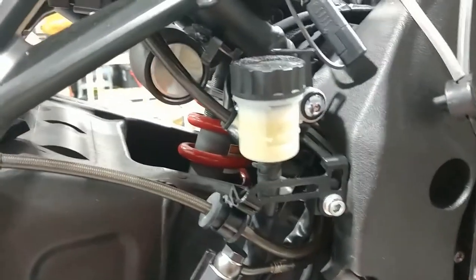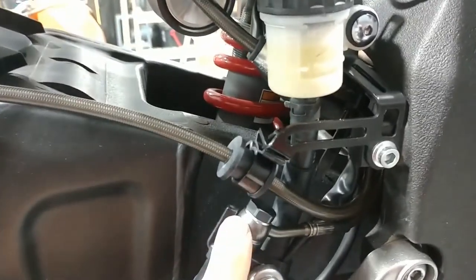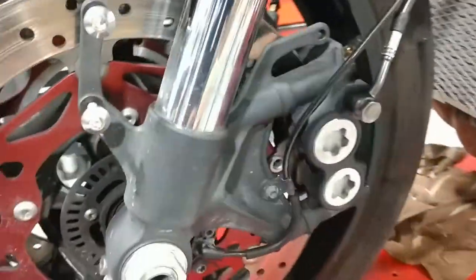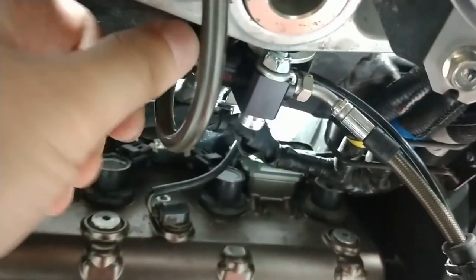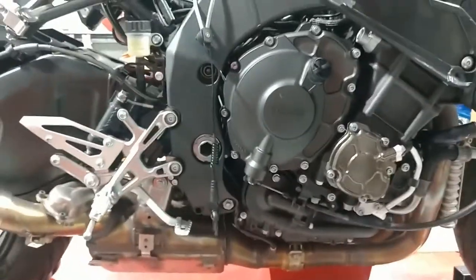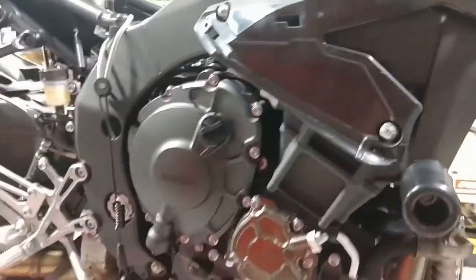We just wrapped up with the bleed front and rear. We built pressure, everything's tight, there are no leaks — we've checked all the banjo bolts, fittings, and all the bleeders. We're ensuring that everything is tight, routed properly, and there are no interference issues at full steering lock. This is obviously a safety-critical system — you don't want to play with your life with your brakes, so ensure everything is done perfectly. Up here check for any leaks and drips coming from that manifold block. Provided you're good, you're ready to get the bike back together and enjoy much better brake feel. Next video we're going to talk about how to install a radial master cylinder and some quirks with modifying the brake switch for the cruise control. Until then, enjoy the new brake lines and ride safe.